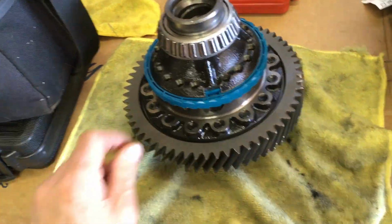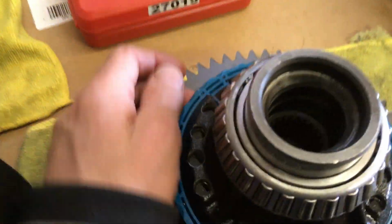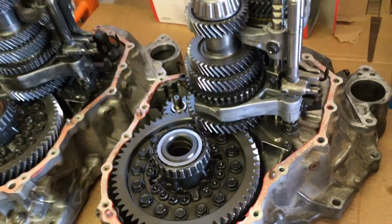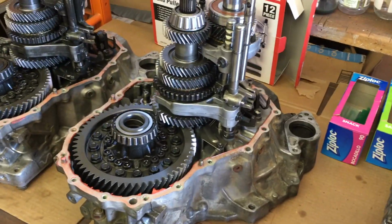Originally, I was going to just buy this and use this speedometer ring gear, because that's broken in the parts car one. So we're shifting parts from one to the other all over the place trying to find compatible stuff. And in the meantime, I wanted to figure out why the Solara transmission had problems. That car actually had problems with 4th and 5th gear, and made a growling noise on deceleration, all kinds of weird things.